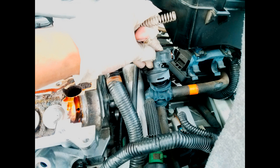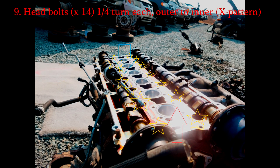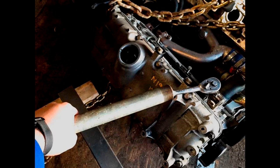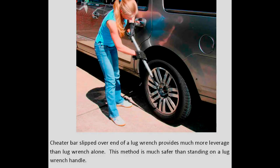The next things to do: be careful — I broke my brake booster valve, but I got another one at the junkyard. Let's get these head bolts off. They're very tough — on there at about 300 foot-pounds probably. You have to go in a criss-cross pattern, starting from the outside, working your way in. You might even need two people to break them loose. Use a cheater bar — put a big pipe over your half-inch drive breaker bar. That's how you're going to get this head bolt off because it is on there very tight.